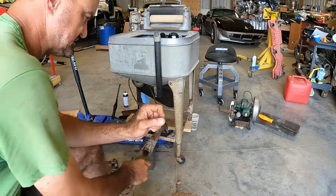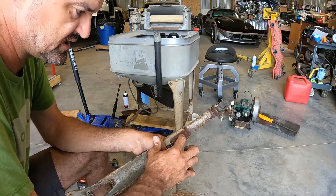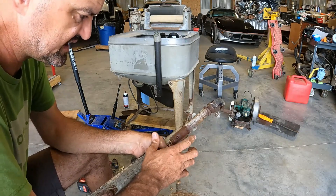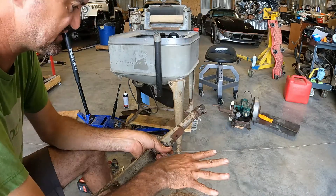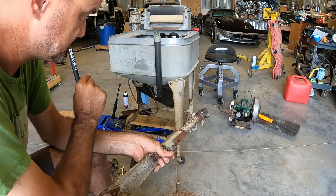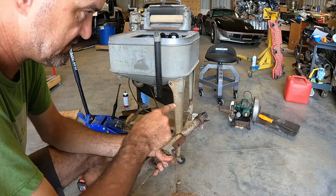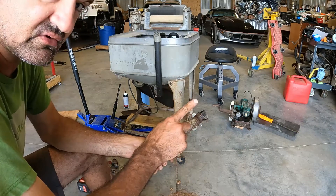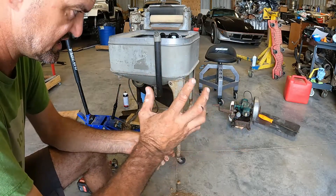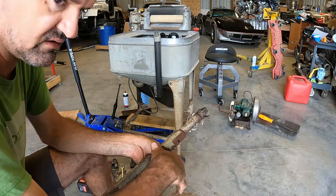What I'm going to try to do is lower this tray by about three quarters of an inch, which means lowering the hole on each leg — the threaded hole that mounts to that tray — on each leg by three quarters of an inch. And that should give us just enough room to mount, to put quarter-inch plate steel on top of that tray, mount our 72 engine to the quarter-plate steel, and have the adjustability for the belt, and it'll work with the kickstart, and the exhaust won't bind, and all that good stuff.